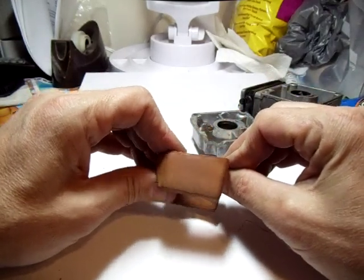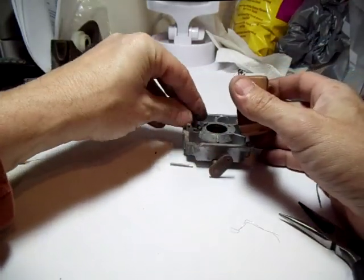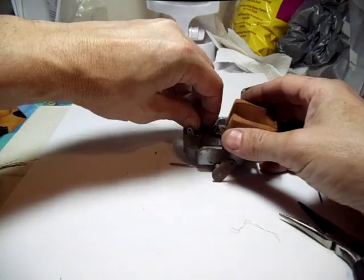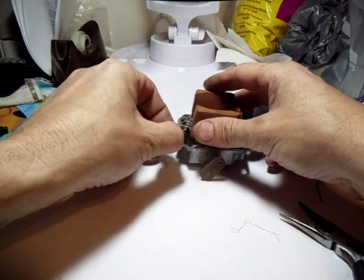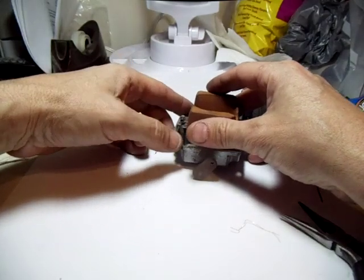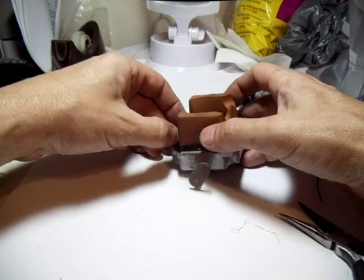Because of that crack, there's looseness at the prong and the gasket just flexes. It's way loose and then the needle will not seat properly, which leads to the pump pumping in more fuel than the carburetor can handle. Then the carburetor starts to flood out the engine. If you take the air cleaner off, you'll see fuel spraying up out of the carburetor. That's because it just cannot get a good solid seat.